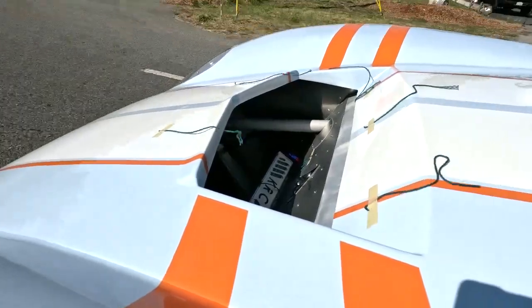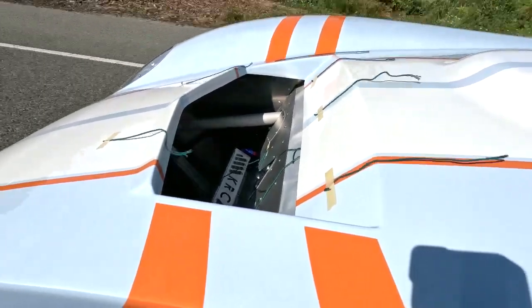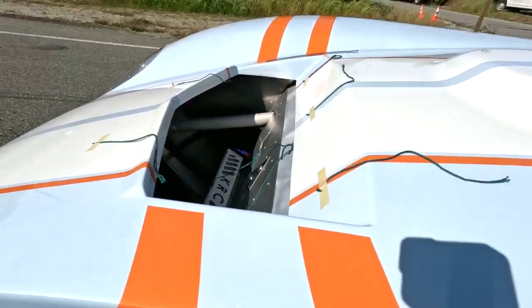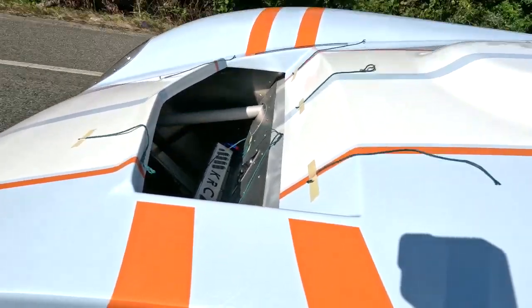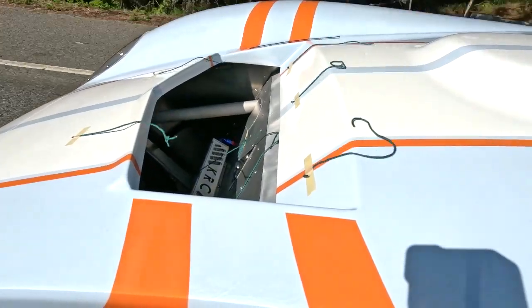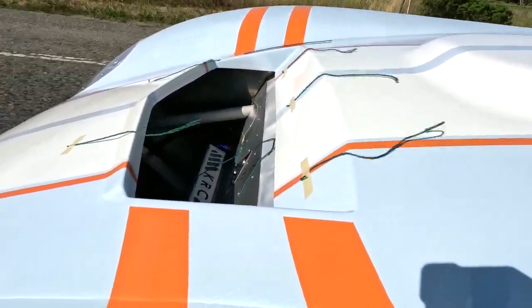Getting up to speed, you can see the yarn starting to do some crazy things. If you look at the yarn on the front end of the nose to your left, that looks pretty well attached - the yarn's hitting that front little lip before going over the opening of the hood, bouncing around a little bit but not bad. The yarn on the back edge of the opening of the hood lays pretty flat. On the flat part there it's laying flat, but once it gets up over the edge of the hood it's definitely bouncing around.